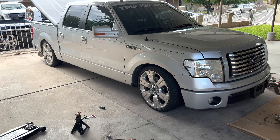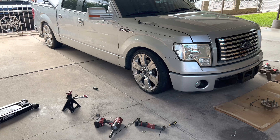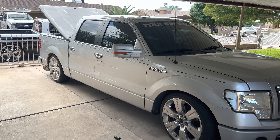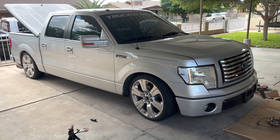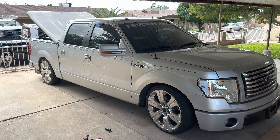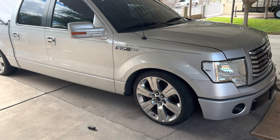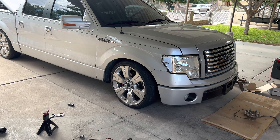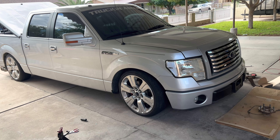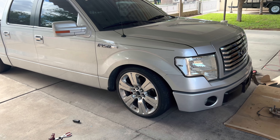For anybody dropping a 12th gen F-150, the only way to align your camber is with the IHC upper control arms and spindles. If you don't have those you'd have to slot your lower control arm holes, which isn't really recommendable. For 2009–2014 models — note that 2014 varies depending on which half of the year it was made: second-half 2014s can use 2015-and-up suspension; first-half 2014s use 2009–2013 suspension. I recommend getting twin spindles — that'll allow you to have zero camber. Get the Belltech drop kit with flip kit rear shocks and front struts, and with the spindles and struts you can go up to five-and-a-half inches.